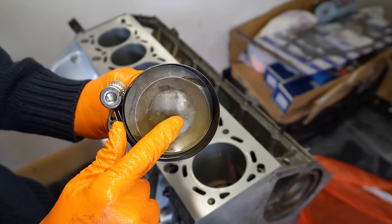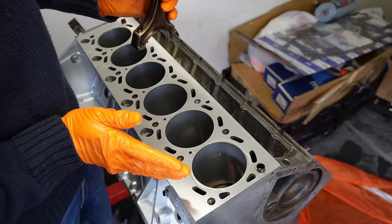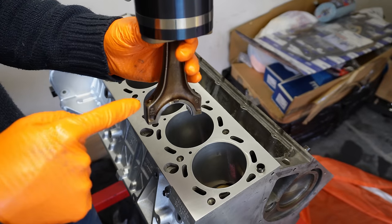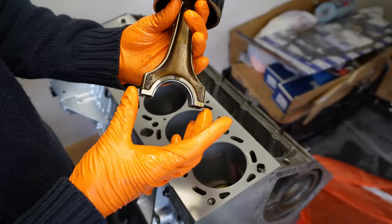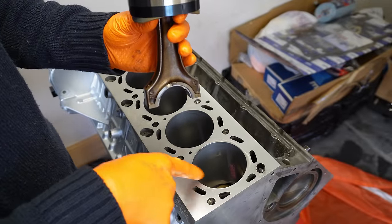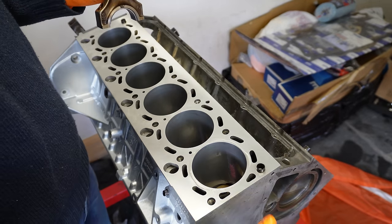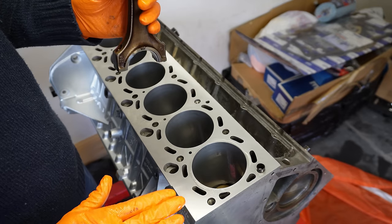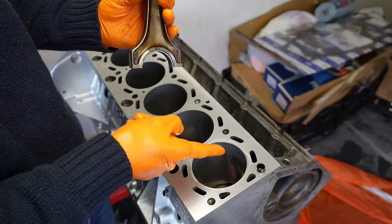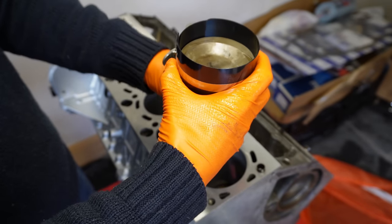All 12 of the cylinders have this arrow on the top, and that shows the orientation of the piston inside the block itself. It should always be pointing forwards to the front of the engine, so that's very important that you follow that direction. When you're dropping the piston in, I suppose you can make an extra effort to make sure that the bottom of the connecting rod here is protected, so it doesn't do any damage to the cylinder wall. What I find, if you rotate the block to this kind of angle, whereby the deck is perfectly flat and horizontal in all planes, it just kind of floats down the middle of the cylinder, and even if it taps off the cylinder wall, it's all lubricated up. It's a super hard surface. It's not going to do any damage in the slightest. So let's just slide this down.